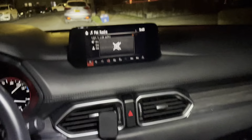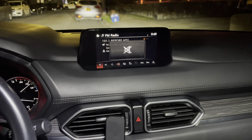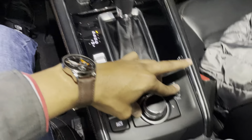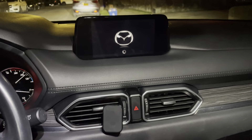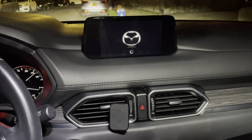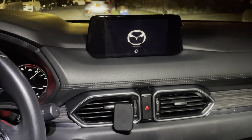Push the mute button and hold it for about 10 seconds. That's going to cause the system to do a hard reset. You can let go once you see the rebooting screen, and just leave it there for about 10 to 20 seconds — that should fix the problem.